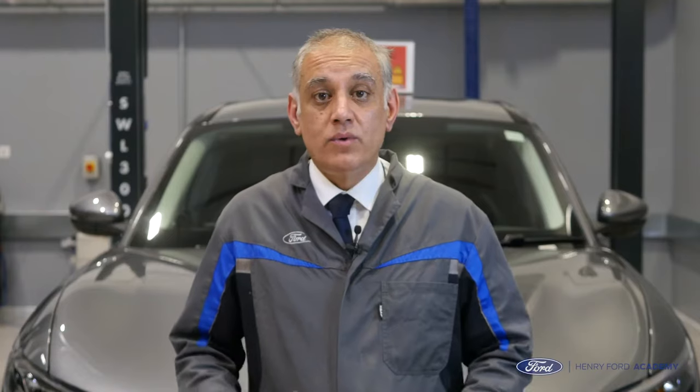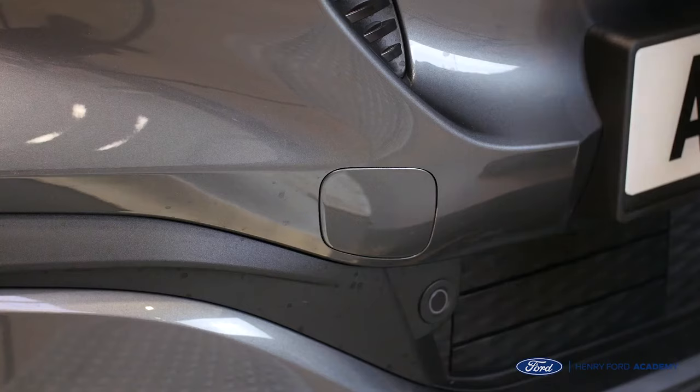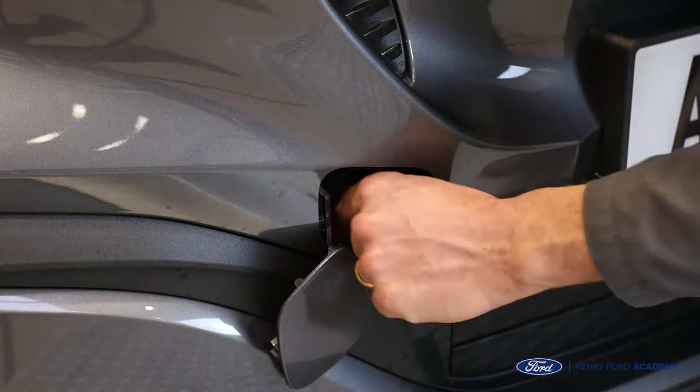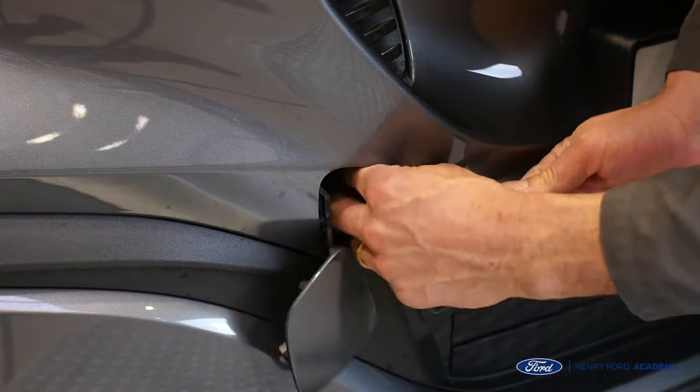Back at the front of the vehicle — remember, in our scenario 48 hours have passed since the 12 volt battery became discharged, so the capacitors weren't able to hold any charge and pressing the button to gain access did not work. What we have to do now is push this cover at the top, and once we push that cover we reveal two wires, one red and one black.